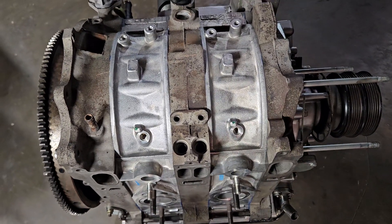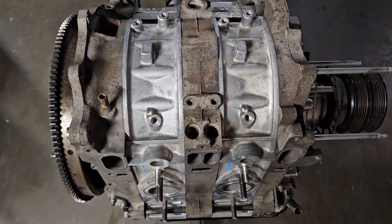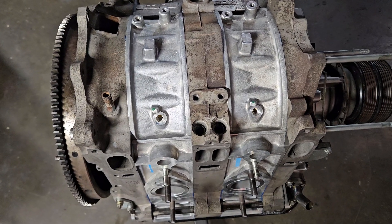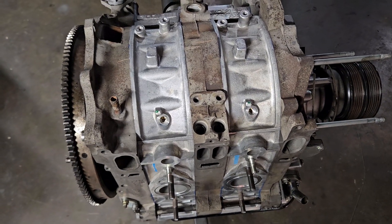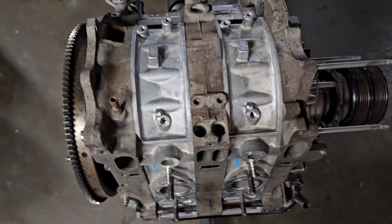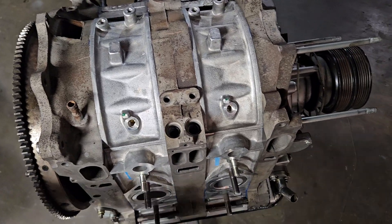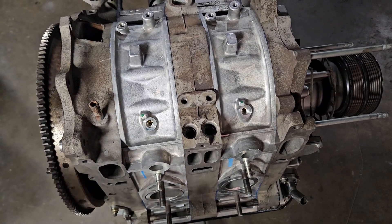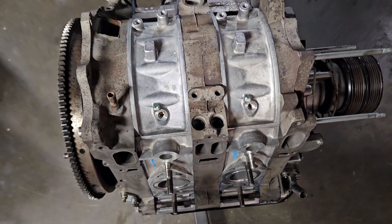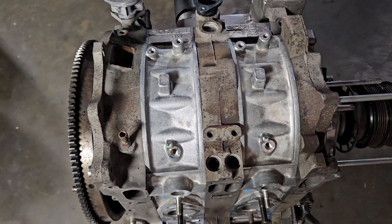When this motor went back together, the customer wanted it as close to original OEM stock as possible, but we wanted to increase reliability. It is a standalone fuel management car and it is getting worked harder than the OEM configuration would have asked. So with those requirements and trying to keep it budget friendly, we basically put together an OEM rebuild: new rotor housings, new bearings, all fresh OEM water seals, all of the rotor kit — your side seals, side springs, corner seals — all OEM.